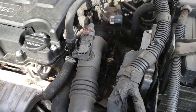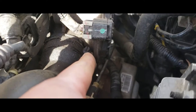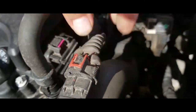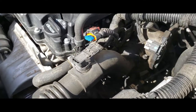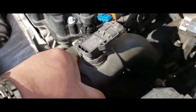The first thing we're going to want to do is remove the charge intake pipe — it's charged because it's turbocharged. So this is the intake piping. We're going to remove that flat-head screw and loosen that up to release this piping. We're also going to loosen up the mass airflow sensor. Charge pipe is loose, and so is the pigtail for the mass airflow intake.